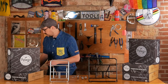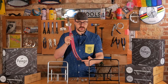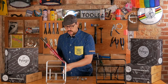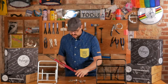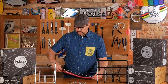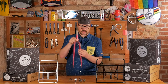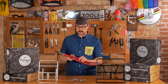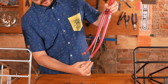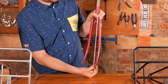Just to demonstrate, I'll show you how to measure that. If you see this road fork here, axle-to-crown means the axle is here and the crown is right up top. You measure that in millimeters — from the center of the axle up to the crown of the fork, meaning right up at the top below where the headset would sit. You can just measure to the bottom of the headset. Measuring this out, it looks to be roughly 362 millimeters on this fork.